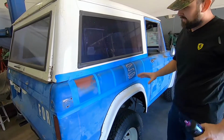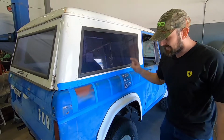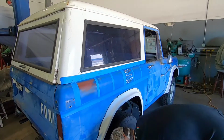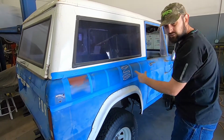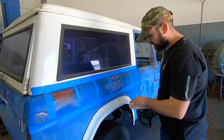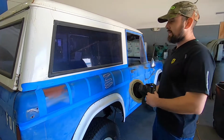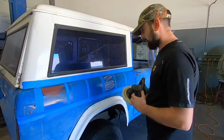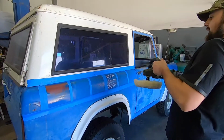The rotary, I will say, is absolutely the least forgiving. You will burn your paint like this fast if you run a rotary dry. That's why you'll see I always pre-prime it with a bunch. I mean, I use 3 times as much compound on a rotary as I do with any other style of buffer. The Flex, I mean, the Menzerna goes a long way with the Flex. I could do dang near a whole panel with that amount.